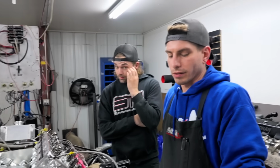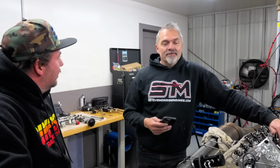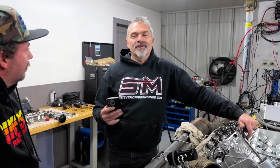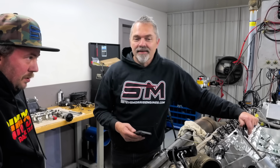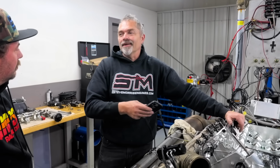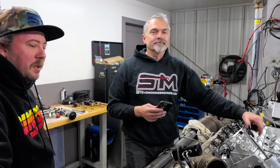Because that oil even sloshing in that tank is going to give you weight transfer and a weight bias change. Well, there's baffles in it and stuff that keep the oil in. But if you leave the lid off of it, I bet oil comes out of the tank. Sure, it does. I'm not going to disagree with the theory, but the practicality is astronomically minimal. Now, if you're moving weight in the car, that's different. But the slosh in the pan and the tank don't work that way, not in reality. Yeah, it's minimal.